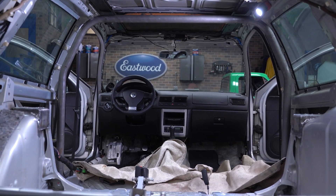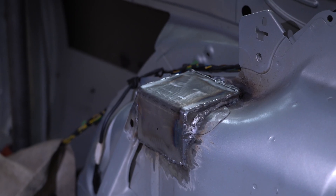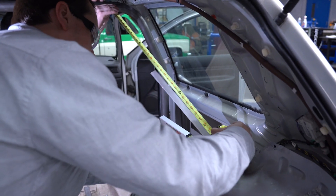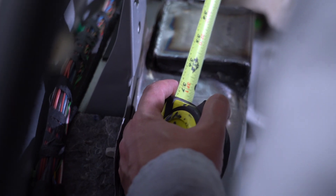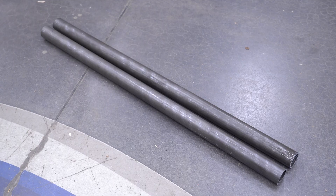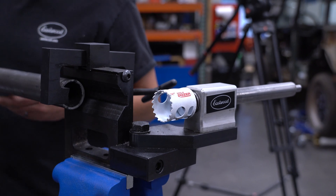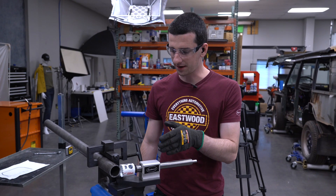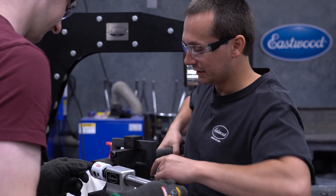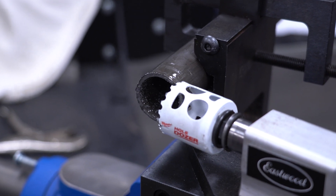We test fit the main hoop and it's looking good. Our next step is to fabricate the backstays to support the main hoop. The base plates the backstays will sit on have already been welded into the car. From that we can work out how long we need these bars to be by measuring from the base plate to the top of the main hoop — we'll leave them a bit long so we can trim to fit later. We also need to figure out the angle they'll sit at left to right, as the bottom sits wider than the top; for us it's 10 degrees. Using our length and angle measurements we move over to the tubing notcher and cut one end of each bar. We set up the tubing notcher just a little bit offset from the center line of the pipe for a better mated fit with the main hoop. If you do it exactly at the center line you'd end up with a thin section you'd grind off anyway before welding, so doing it this way gives us a better welding joint.